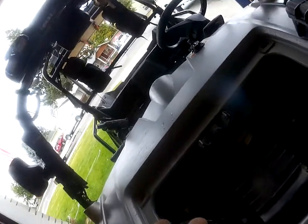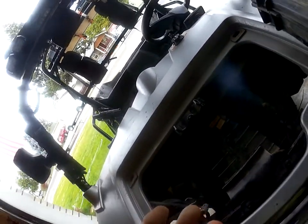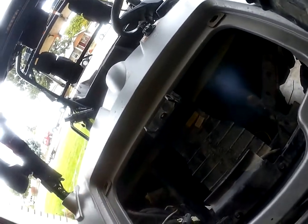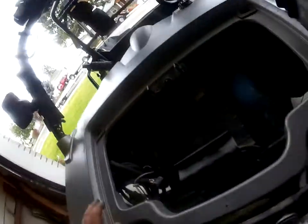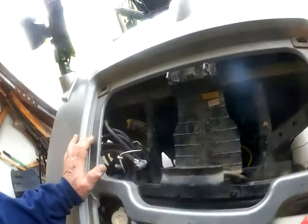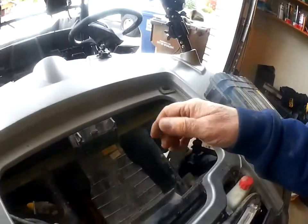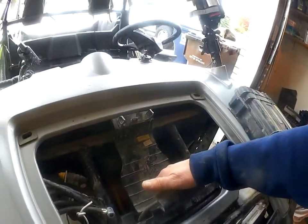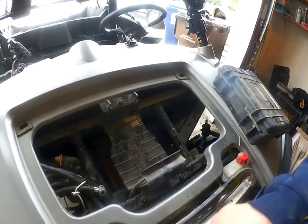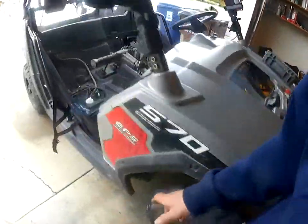When the transmission gets hot or cold, it will pressure out or vacuum in freely. Stuff's going to go down inside the transmission, get all that transmission fluid and gear oil all dirty, which makes for wear and tear. So I've got to take this hose, like the guy online that I talked to, route it through the firewall, bring it on back. It's okay if it's long, and bring all 3 hoses up to a standard point up here.